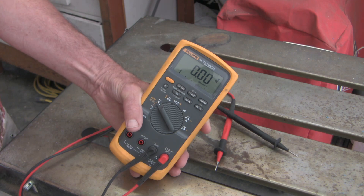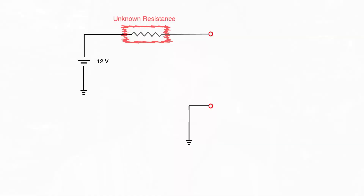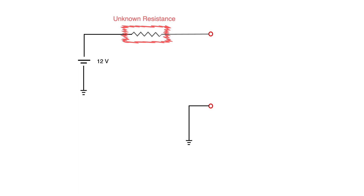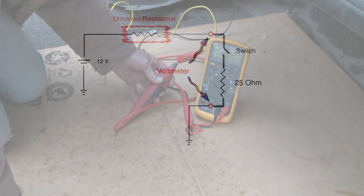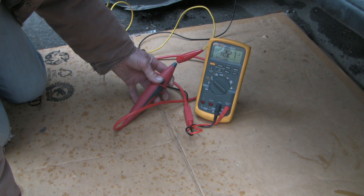Let's move on to an analogy that's much more interesting. You introduced a fixed resistance, got air moving, and measured the pressure drop across that fixed resistance — using it to estimate the resistance to air escape from the engine cylinder. Does that strategy sound familiar? This is exactly analogous to voltage drop testing in electronics. You want to quantify the dynamic resistance in a circuit, so you introduce a known fixed resistance, get electrons flowing, and measure the voltage drop across that known resistance. A big drop across the introduced resistance means resistance downstream is minimal.